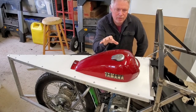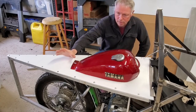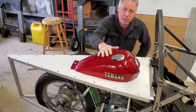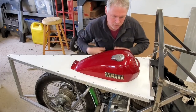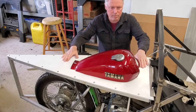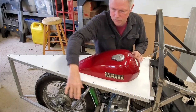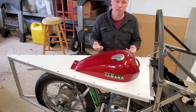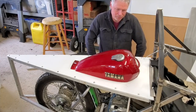I've favored keeping the gas tank here the way it is. The aluminum gas tank I had that I was going to move over here had some advantages: I would have had more storage area, and the gas tank would have been contained outside of the cockpit area. But I've got it right above the motor, just like it would be on any motorcycle. I'll have some vent holes along the sides for the heat to escape, kind of like I did on my first trike. But will that create enough heat to cook the gas? It's kind of like a pot sitting over a burner. I've got to be really careful.